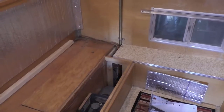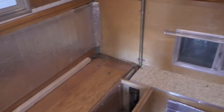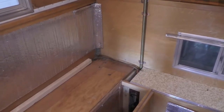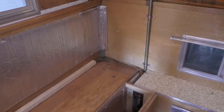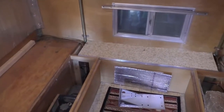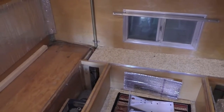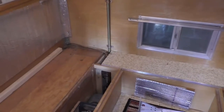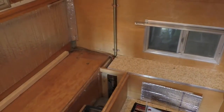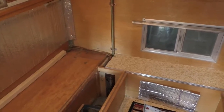So Brian told me to install the jacks 9 inches on center from the front and from the back of the camper. And this is obviously up at the front, right where the cabover goes up. And then to cheat them both out 3 inches. And my question, of course, was, well, why did I buy the extended brackets then if they're both going to be coming out, if I'm cheating them both out 3 inches, then they're both going to be out the exact same width. It doesn't help me getting around the tires. Even though I don't have a dually, I want that extra width. He said it's not about that, it's about supporting the camper, and the extended brackets are better for that,